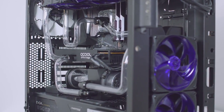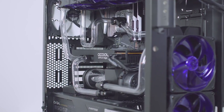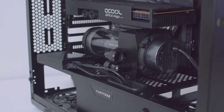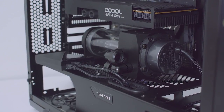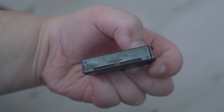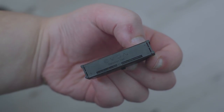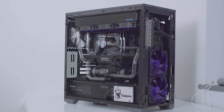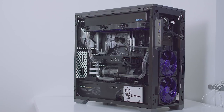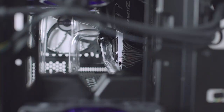You need to only power the pump up — nothing else — in case there are leaks. I recommend using a separate PSU or disconnecting the system's PSU from everything else but the pump. You can force a PSU on with the paperclip trick; links are in the description. In my case I'm using the power-on tester that EVGA provided with their Supernova PSU — it's exactly the paperclip trick but in a nicer package. Very important: stop the PSU before the pump runs out of coolant, otherwise you risk burning it.